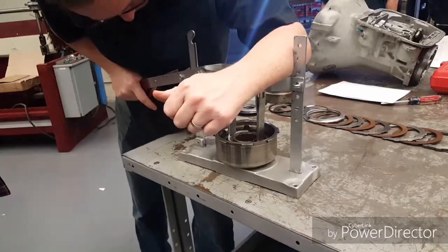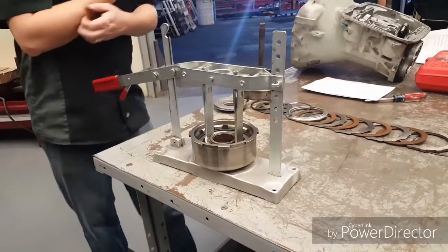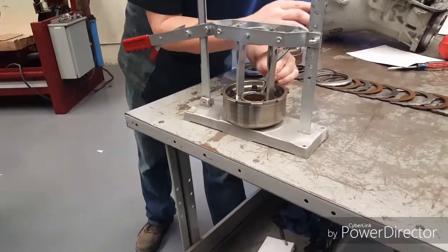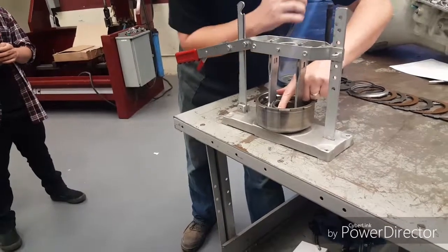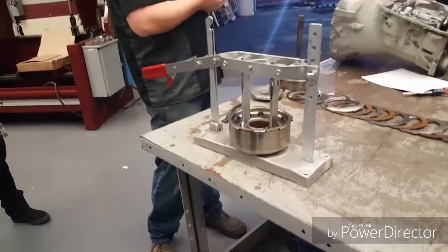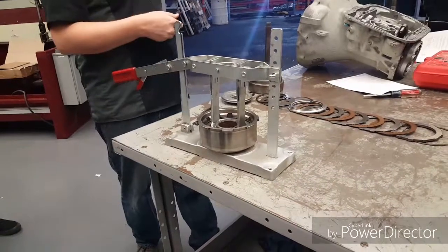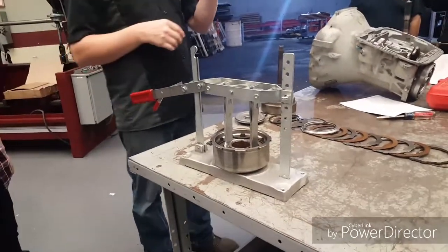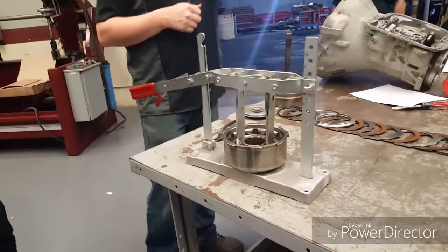Once we start pressing down on this thing, I'll remind you again: it's more comfortable to choke it in there so it's not going to slip off, but you've got to have some space for the snap ring to be able to come out. So towards the edge, as even as we can get it, and then compress just enough to get the snap ring out — going any further than just enough just loads this thing up and asks for even more trouble. Also, I had a finger through the core as I was taking this off so that if it popped, it would catch. If these things go flying across the floor, you may end up on the floor of your shop for half an hour trying to find the snap ring that's already gone out the door. So I try to keep them from escaping.